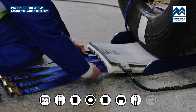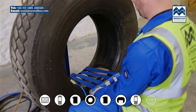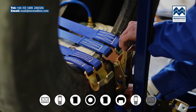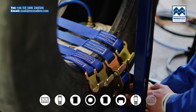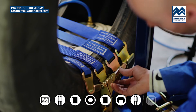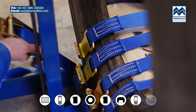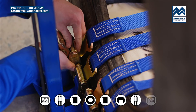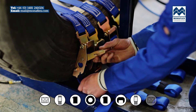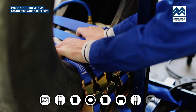Lift the external curing pack up into place and pass the hooks through the centre of the tyre. The curing pack and heat pad should be positioned centrally over the repair. With the hooks hanging down on the sidewall furthest from the repair, starting from the central strap and working out evenly, bring the buckles up and commence fastening each strap. The straps should be fastened so that buckles are equally spaced and the beads should be pulled together approximately 10% of the relaxed state. Between the beads, check each strap is of a similar tension.